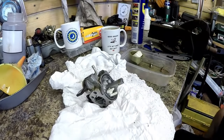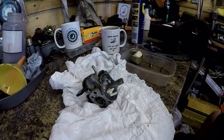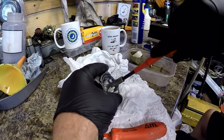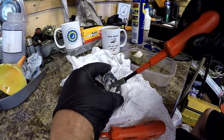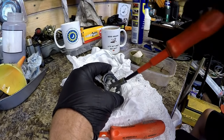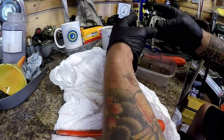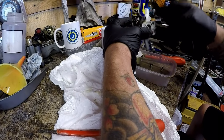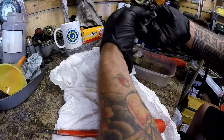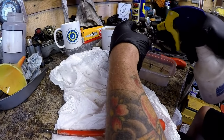Nope, slightly smaller, I'll say. Need to be a bit careful because these jets, I don't like to come out. Let me try that one. If that's got it or not. Yeah, it has. It's just not running as well as I would like. There it goes. The tubes come out as well, which is good. I'm going into here as well, so I'm going to give it a quick spray of WD-40. I'll give it an air compress off once that's had time just to soak off.